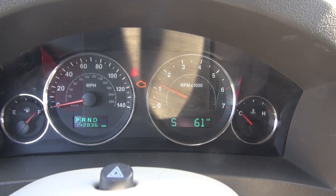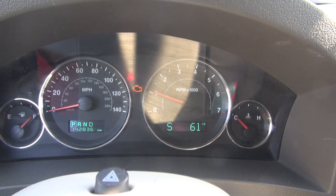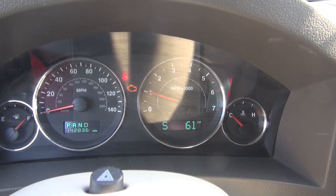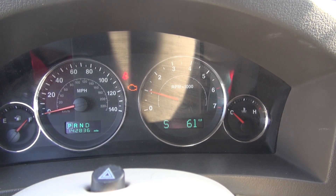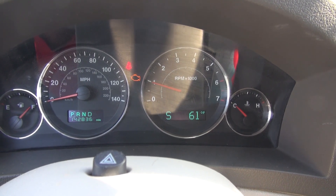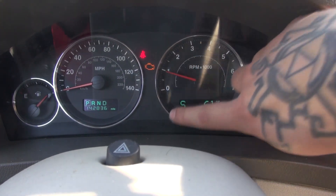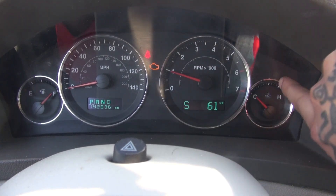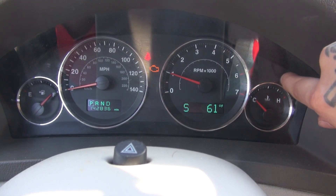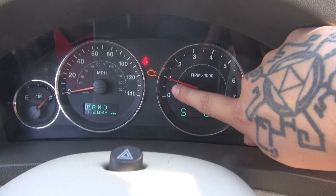What happens, you'll see in just a second, it'll start sputtering and the needle is just very inconsistent. If I leave the car in idle like this, then it will completely stall out after just a couple of minutes. Also, if I drive it, the ABS ESP light comes on, and then also the skid or traction control light comes on. The needle just goes up and down a lot.